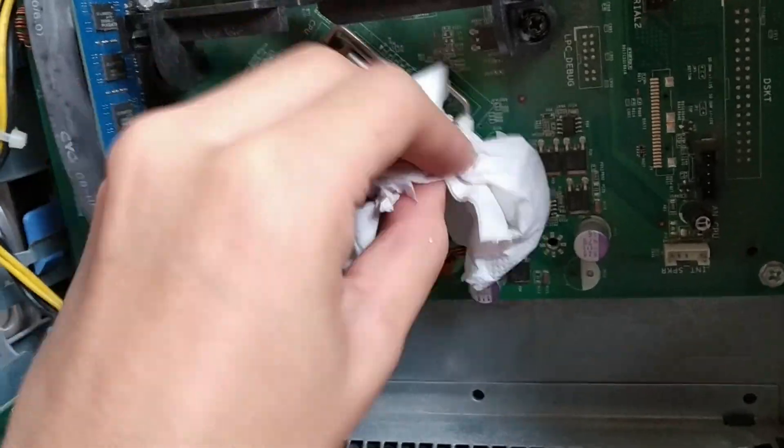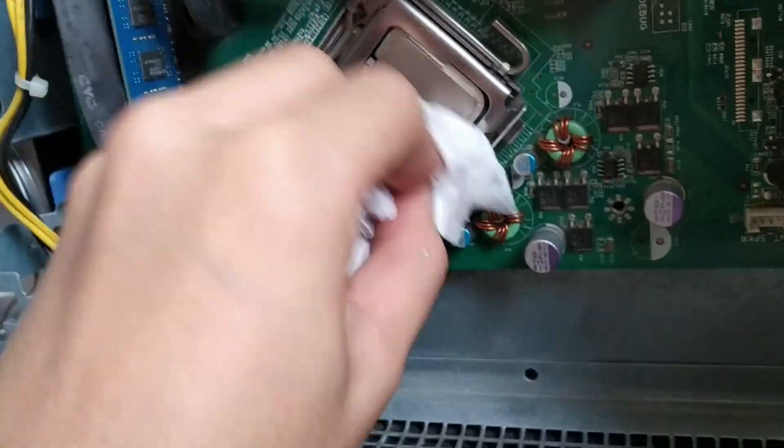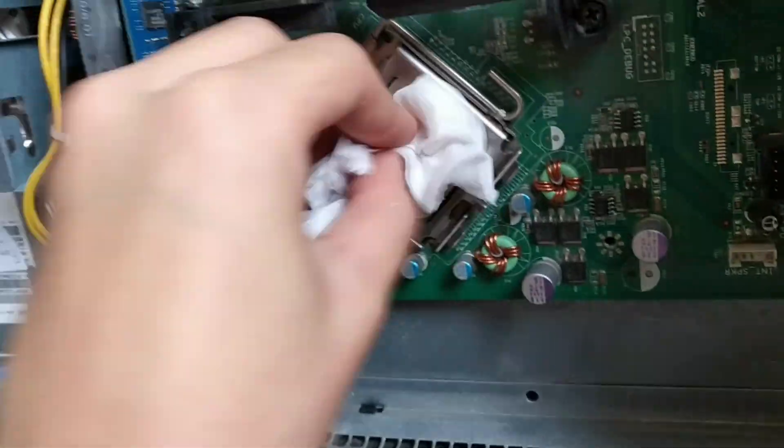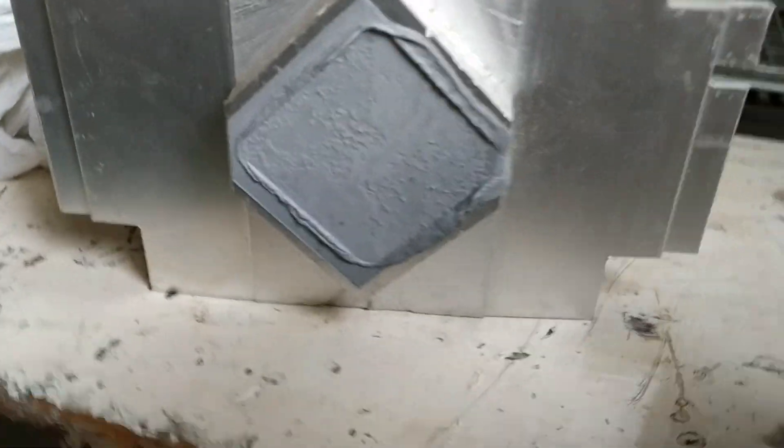As you can see, this is really old — it's just falling down, and it should not be. So you really just want to use tissue paper and clean it up. The central processing unit here is an Intel Core 2 Duo processor — not exactly fast, right? Same thing on the heat sink — you just want to clean up all this old thermal paste, get rid of all this old stuff. It should be nice and shiny, and then you can put on new thermal paste.